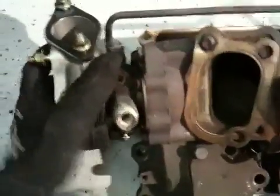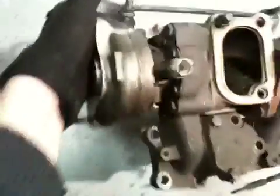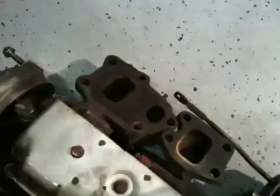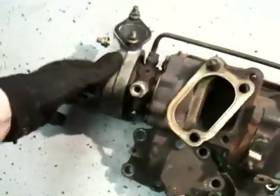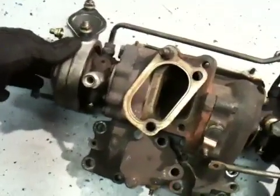The twins — if you pretended that this was a turbocharger, look at how small it is. That is a small turbocharger, and it would definitely produce what's called exhaust back pressure, meaning the engine is pushing really hard on the intakes for the turbos and they can't even get the air out fast enough. That's called exhaust back pressure. Too small of a turbo — yeah, it spools up real quick, but then it taps out and runs out of breath, more or less.